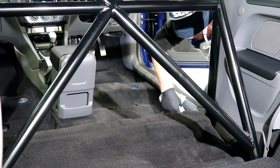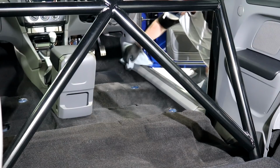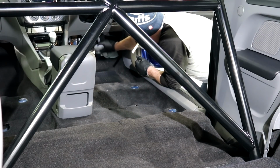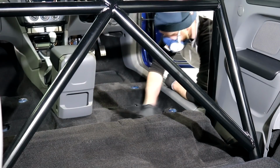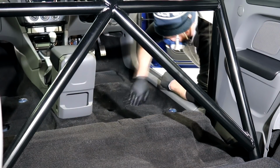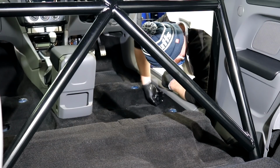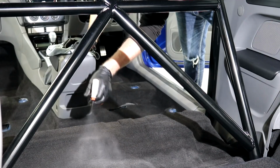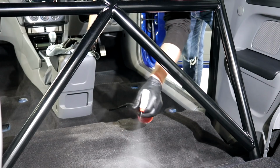Immediately take your interior detailer or all-purpose cleaner and wipe over those affected panels. If you don't, the fabric guard will dry like glue and it will leave very noticeable stains on any hard surface. After the plastics have been wiped down, I wipe across all areas of the fabric to work the fabric guard into the fibres. This technique will ensure that the fabric guard does not dry in clumps on top of your fabric, and also by wiping down all areas you will actually get to feel that all parts of the fabric are protected.